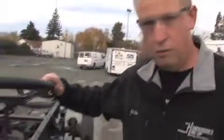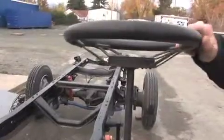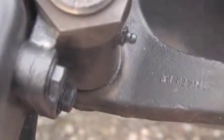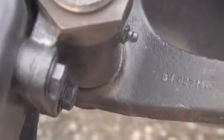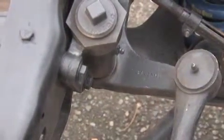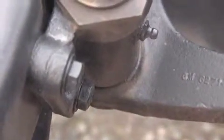This chassis has two bell cranks, one on each side, and first we'll show you what to look for on these parts. When I rock the steering wheel lightly, if you look at this movement here on the end of the shaft where the arm is attached, you can see it rocks side to side. That's pretty common on these. A little bit of play there translates to a lot of play at the steering wheel. I'm moving the steering wheel about probably three inches up here and the tires aren't moving.